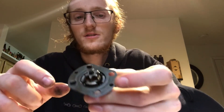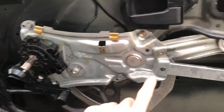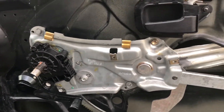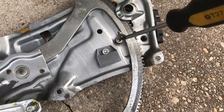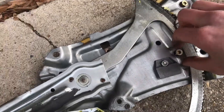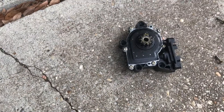That's all you need — this is what you need. The next thing is to remove your old regulator. Usually there are rivets, but I've already changed this one so I just replaced them with nuts and bolts. There are plenty of videos online on how to do that. Once the regulator is off, you're going to remove these three torx bolts, which I've already loosened, and once they're off you can remove the motor.